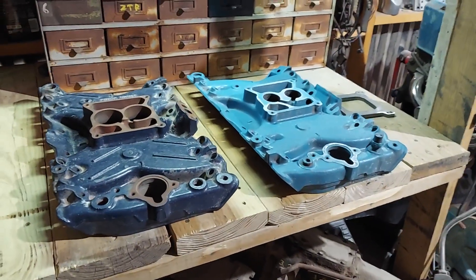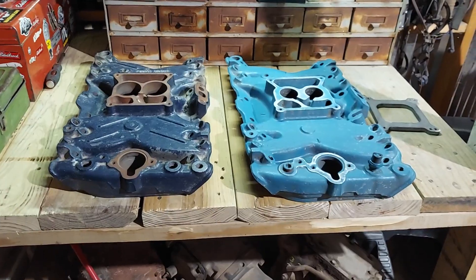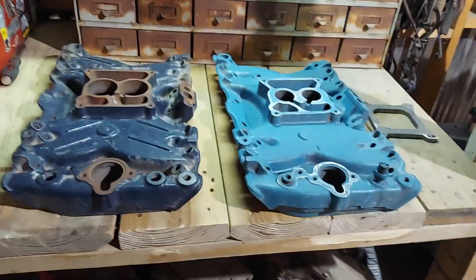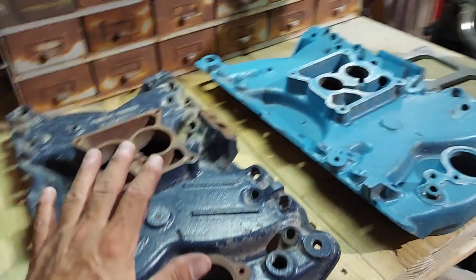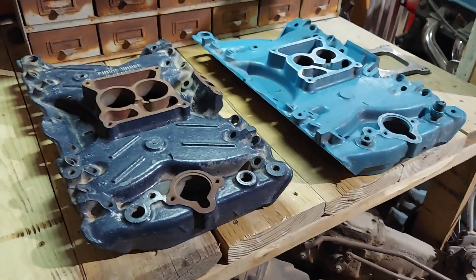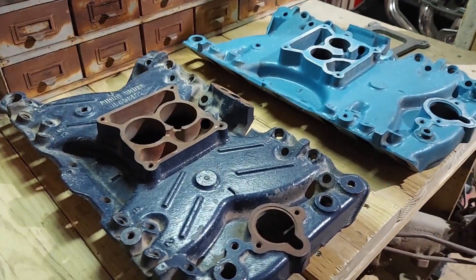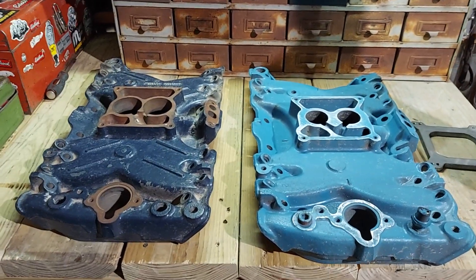A lot of these older vehicles had problems over the years. People realized it's hard to find parts for these fuel-injected vehicles — there aren't many mechanics who know how to diagnose them, and replacement parts are very hard to find. If you want to convert to carburetor, I would recommend completely removing this intake manifold and getting a regular Oldsmobile dual-plane intake manifold made for a carburetor, then changing the distributor to a regular non-computerized one. That way you can completely do away with the computer, all the harness, and just run a regular carburetor.